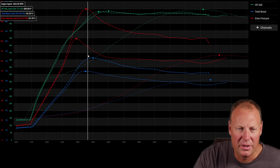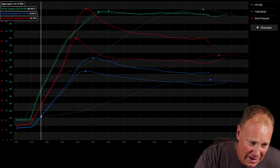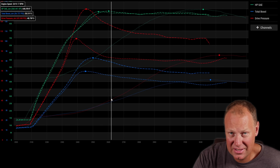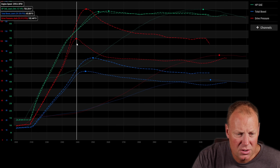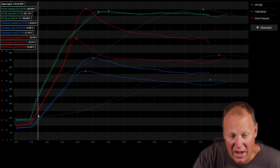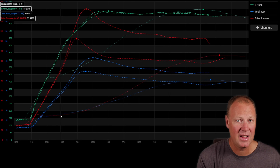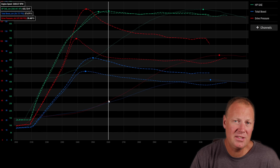You can clearly see where the wastegate opens in the drive pressure graph — that's exactly what's being affected when the wastegate opens. We drove this and it went pretty well; on the street you wouldn't realize how lazy it was until you got into the better-tuned one. With the wastegate opening way down low, drive dips a little bit and hangs out down low — this is where it starts to drive the big turbo. In an internal wastegate setup, it's just bypassing the turbine of the small one and going right into that exhaust pipe, hitting the big turbocharger.